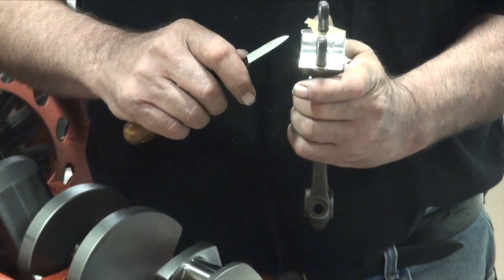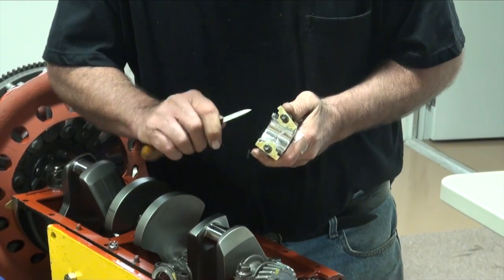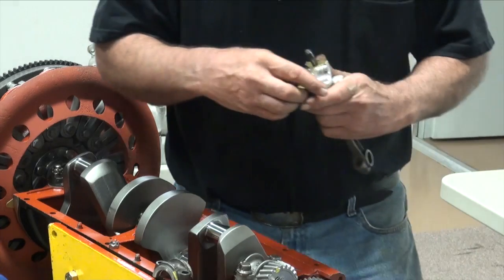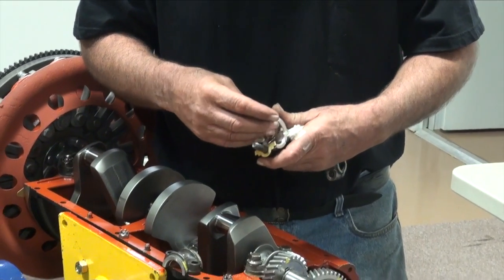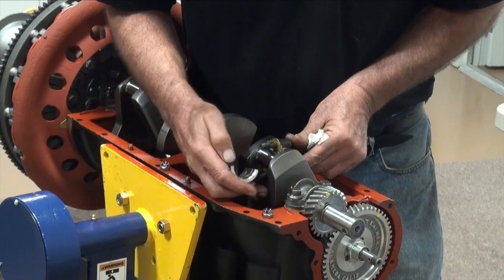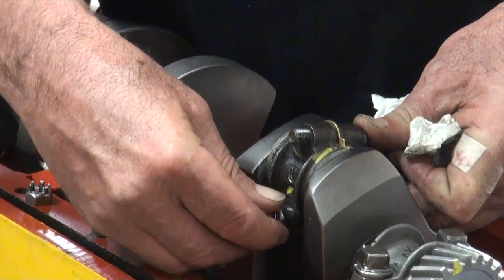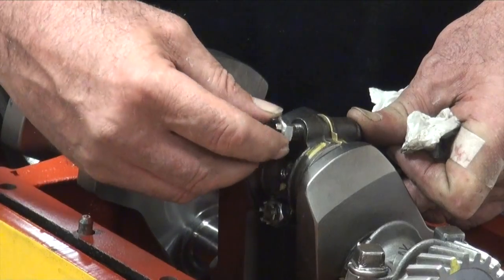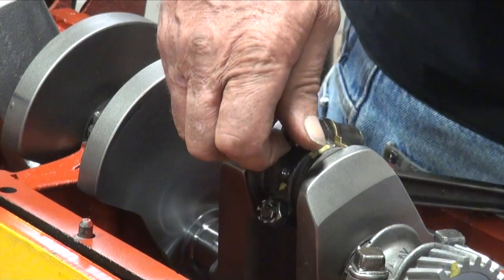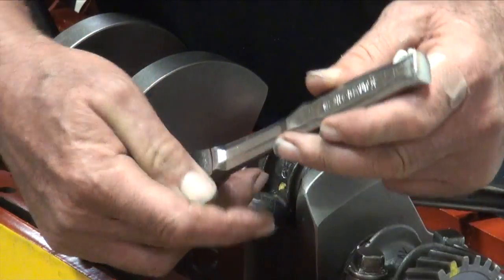Right here in that radius is where it's really shiny — there and here. I'm just cutting that out of the way. The thrust is this surface; the radius doesn't come in contact with anything. We have our rods all indexed and marked so we don't put the cap on backwards or get the wrong cap on the wrong rod. You can sort through it if you happen to get them mixed up, but it just takes time.